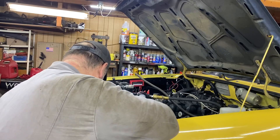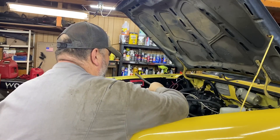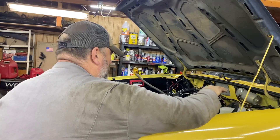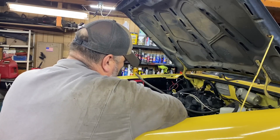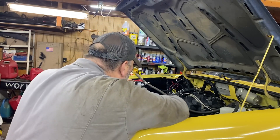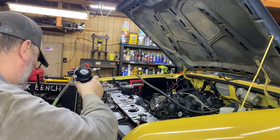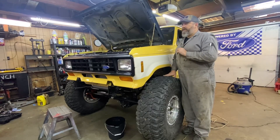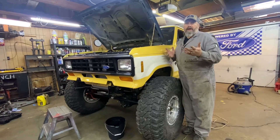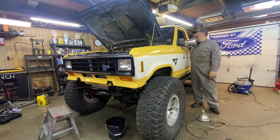Yes, that's it. All right. Let me close it — oh yeah, okay. Let me see how we did. Pull it out — damn, right to the top. Okay, cooling system is full. So the cooling system is now completely full, should be burped of all air. We have the new coil packs on, we have the new fuel injectors in. Should start, and that miss should be completely gone. Let's hit the key and see what we got. Fuel system is primed. Here we go.